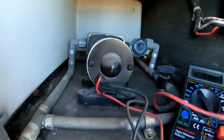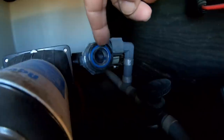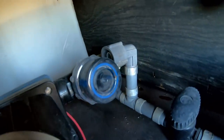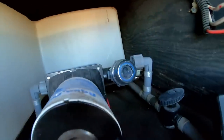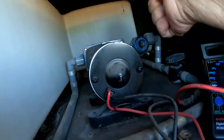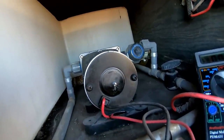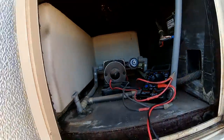These pumps do have an inline screen filter — the inlet side of the pump. It is very clear, not plugged up or anything. Yeah, I ought to whack it with a hammer, but I'm better than 90% certain that this pump has failed. So that's it — what we have to do is get to the RV store today and pick up a new pump. That's pretty easy to diagnose.